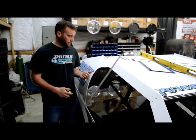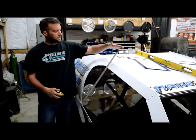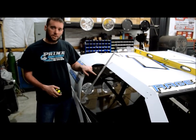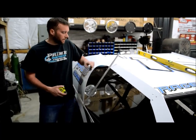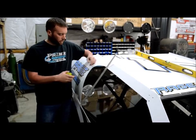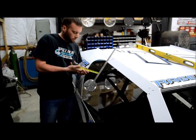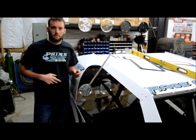Rule 4.8 is still talking about sail panels, now covering the amount of bow. Get a flat piece of steel — you may have no more than 4 inches of bow in that sail panel. With the flat piece of steel at the corner of your deck and up at the top of the roof, take your tape, make your reading to the outer piece of the sheet metal — no more than 4 inches.